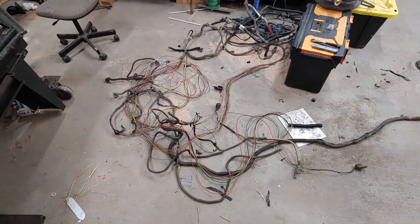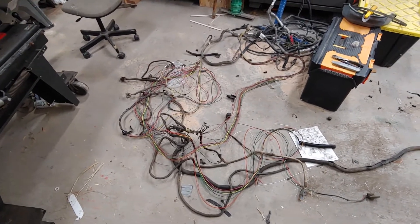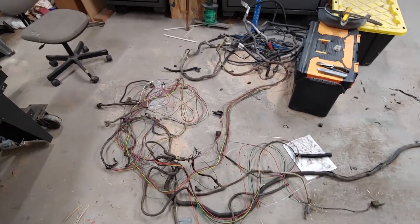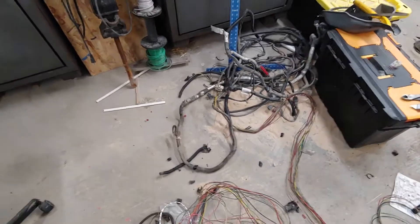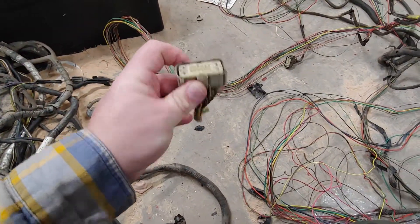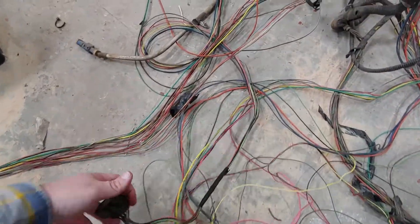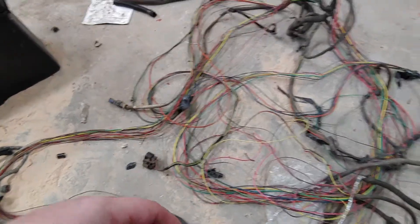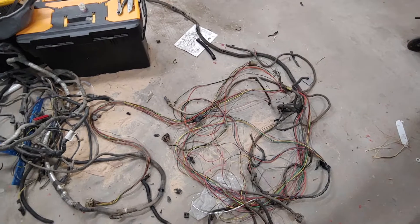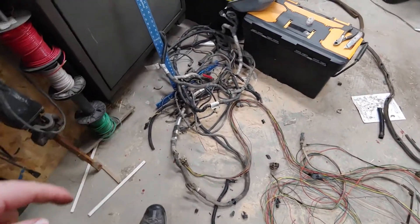This truck only had three oxygen sensors, but they're provisioned for up to five, where they'd have two sets of catalytic converters. This one only had one cat converter with the integral oxygen sensor. My plan — and I've already got a nice diagram drawn up which I'll show you in my next video — is to take the relevant wires out of these connectors. There are three connectors: this is one connector, this is the second connector — it looks just like it except it's black instead of gray — and this is the third connector. All three connectors have wires that we need.